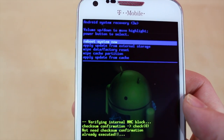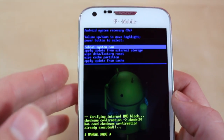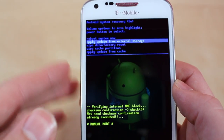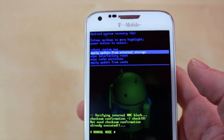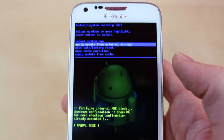This screen is going to take you to the Android System Recovery. To navigate through this system, you're going to use the up and down rocker to go up and down, and if you want to select something, you click the menu button or the power button — it's different on different phones. On this phone it's Ice Cream Sandwich, so it might be a little different from Gingerbread or whatever software you have.